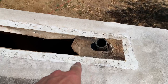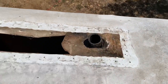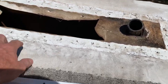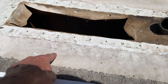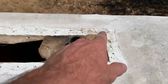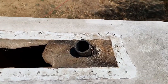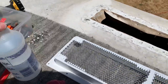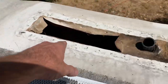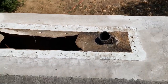Once you've got your edge cleaned up — all the excess butyl tape and self-leveling sealant — since this is an EPDM rubber roof they were using self-leveling Dicor. Once you're done with that, go over the edge. You can use mineral spirits very sparingly, but I suggest just using some dish soap and water — put some in a spray bottle, spray it around there, hit it with a rag, go over it a couple of times, and then we can lay down our new sealant.